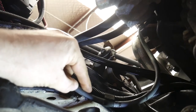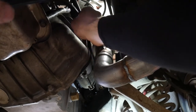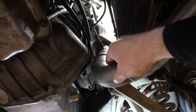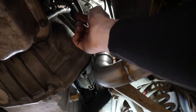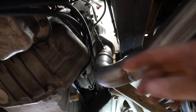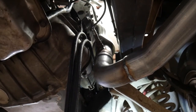Right here I have battery cables I need to reposition - those are going to go behind that motor mount with the battery cables. It looks close to the exhaust right now, but from up top there's about two inches of clearance. The starter's right there too, but there's plenty of airflow so it shouldn't be a big deal. I'm going to mark where this hose needs to be cut. I'll test fit a 45-degree fitting on the transmission before committing.